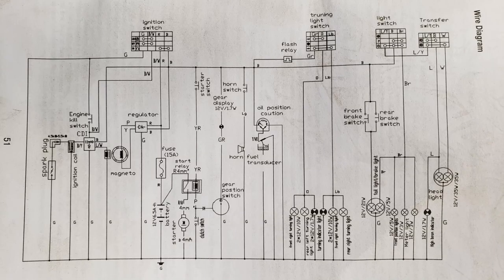To test the headlight switch: the black wire has power coming in, then this wire should be live when you turn it on, which goes to the transfer switch with a high-low switch. This wire is low, this wire is hot, and green is always ground. If your running light is on but your headlights aren't working, check your headlight socket; if that's working, check your ground — you might have a bad connection.